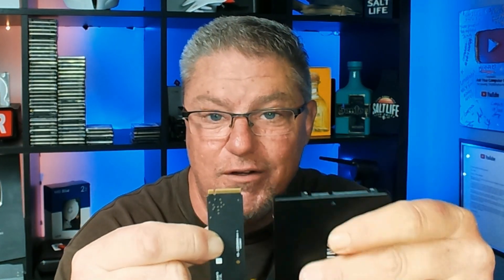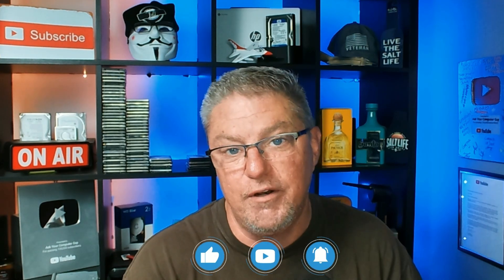The last one on the list is an even newer technology called M.2. What you need to be concerned with is the pins on this — you can see it's obviously much different than your traditional SATA drive. This M.2 is very specific to your particular computer, and generally only a newer computer is going to have these. Some computers do actually have both an M.2 connector and a SATA connector, so you could theoretically plug the SATA drive into a machine that has an M.2 connector, but you would have to boot to that drive instead. At worst, you can always clone the SATA drive onto the M.2 drive — I put the video link up here and in the description.